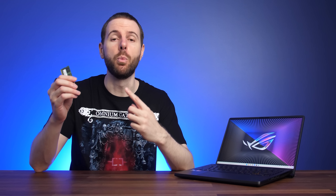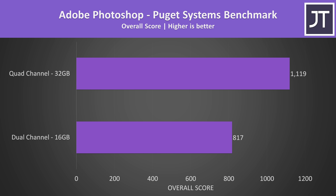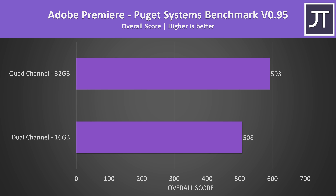It's not all just about gaming though — other workloads had much bigger improvements with the memory stick installed. Compared to the games, content creator workloads had a much larger difference with the memory installed. It's possible, even likely, that some of this is due to the additional capacity, as we're going from 16 gigs available with just the laptop's soldered memory to 32 gigs with the stick installed. This performance difference doesn't really seem to matter in most games, but other applications can clearly use it better.